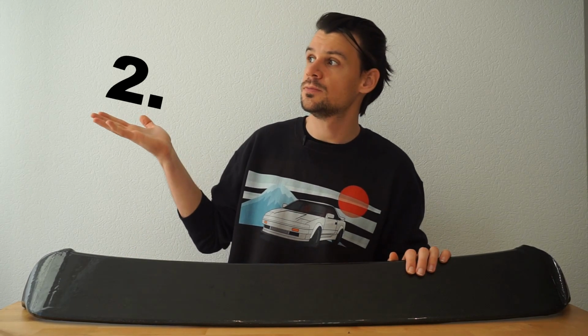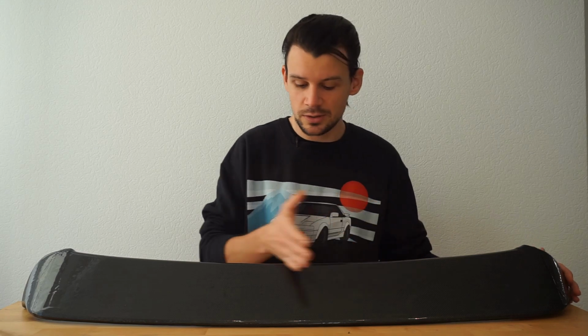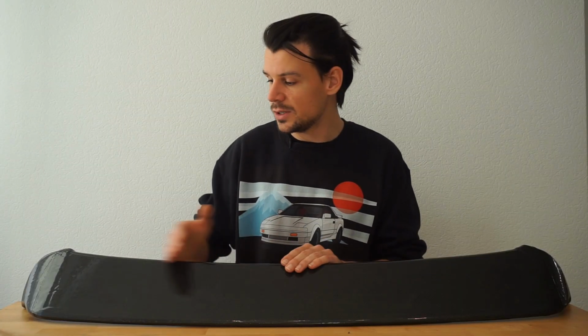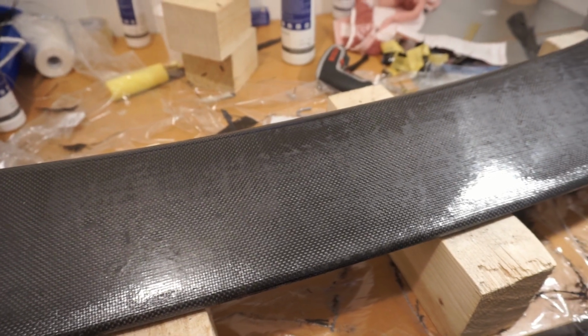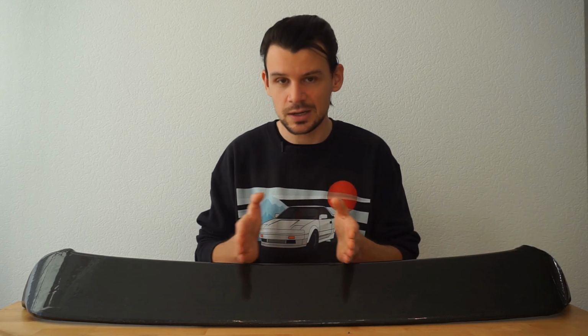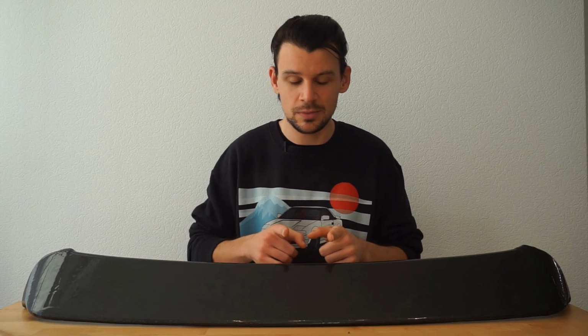Mistake number 2, saving on resin. It's a big problem when you want to do the second layer of resin and you are in the middle of your part and then you realize, oh, I don't have enough resin. When you cannot do the rest of the part, it becomes a very thin layer, and this leads to problems when you want to sand it for the third layer, because you don't want to hurt the carbon fiber, but you need the same hardening time, so you cannot mix another part of resin, because then you have here already hard resin, which is like jelly, but you need to do something like a fading to the new mixture with maybe the same ratio, but you have the big problem that the middle, which is like jelly, and you move, you see these structures.